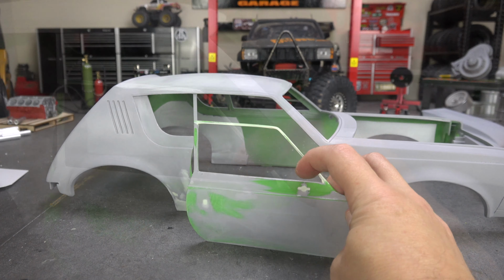And then I've also went in and added some strength to the inside of the frame rail, or inside of the rocker panel there. So you can see that'll give us some good strength to this rocker panel. It's much stiffer now. So it should be much less likely that we crack the body filler here. I'll add another support piece probably right here, just in that seam. But by adding that strip there, I'll be able to build out the door rail here, the door seal along the bottom.